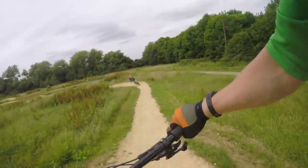We also found that while the suspension works really well when you're plowing through rocky sections, when you're on the power — especially when you're climbing — the tension in the chain is still stopping the suspension from reacting nicely. So it kind of jerks you up and over bumps, especially in seated climbing, which I think is mostly an artifact of that super slack pedaling position where your weight is right over the rear axle, but also to do with the suspension itself. Just because you have quite high anti-squat all the way through the travel, an inevitable consequence is that it's pretty unreactive when the chain is under tension — i.e., when you're pedaling hard. So we all found that the bike did kind of lurch up and down a bit over rough technical climbs. I had an interesting conversation with Darrell Voss, who engineered the React2Play suspension system, and he suggested that the issue could have been down to the shock tune still not being light enough. But actually, I think this is an inevitable consequence of how the bike is designed.